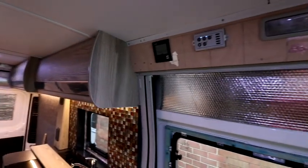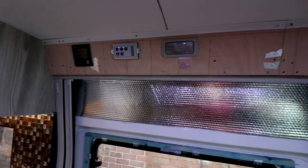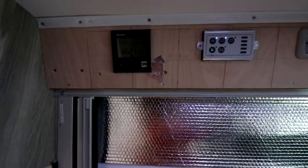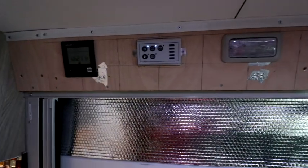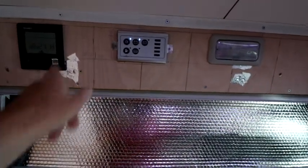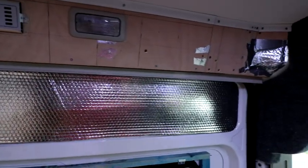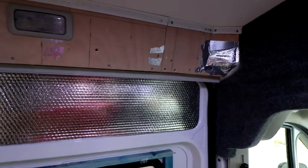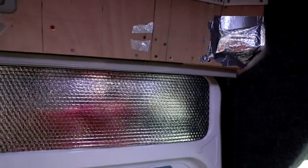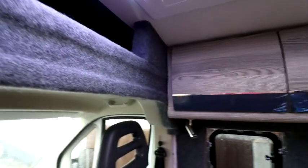Moving down to the end panel for the kitchen wall cupboard — I've just started setting up what I'm calling the communication area, which is just mocked up for now with the Truma unit set in there. I've actually got a fault showing on it because I haven't got the room sensor fitted yet. I've got a cover plate which goes around the outside of that which isn't fitted either, and I'm planning to carpet this area. I'm still waiting for the gas gauge under-tank to arrive, which will probably fit around here somewhere.